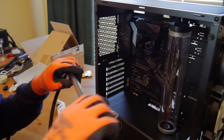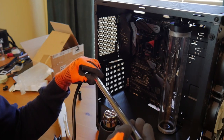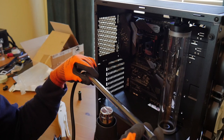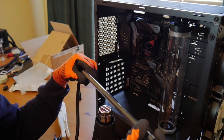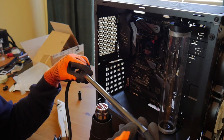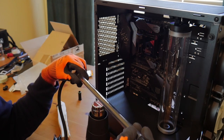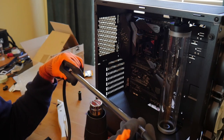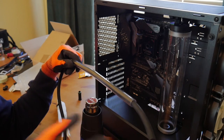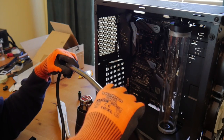I like to have a lot of extra tubing since I'm still pretty new — we've only done about five or six builds. You want to turn your heat gun on and heat up a good section of the tube while spinning it, so you don't heat one side too much. Don't let the gun get too hot otherwise it'll make the tube look bad on the outside and you can get kinks. The 16 millimeter is going to be the most difficult compared to any other PETG — I definitely recommend PETG for first-time building. You can see we're starting to bend, so we're almost warm enough to get the 90-degree bend in.